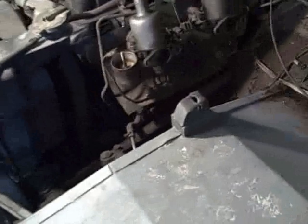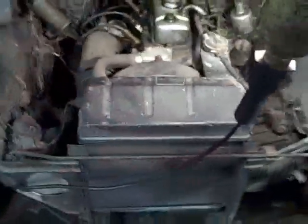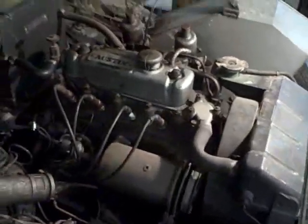I really admire the simplicity on these Bug-Eyes. This is the next thing the car needs - this is the throttle linkage so that as the cable moves you get the butterflies moving inside these SU carbs. These are the correct and original inch-and-an-eighth Bug-Eye carbs, but what happens over time is from every cycle of the throttle you get wear in these little bushings in the throttle shafts on both carburetors. It makes it hard to adjust the carbs well - that's why sometimes people throw away SUs and put Webers on. I love SUs and when they're set up right they work great, but I would take those off, send them to one of the many vendors that will re-bush them, and get them done right so you start with a good foundation.